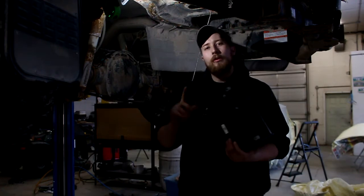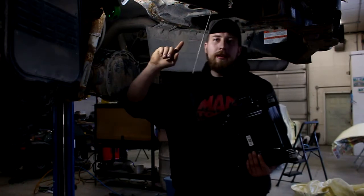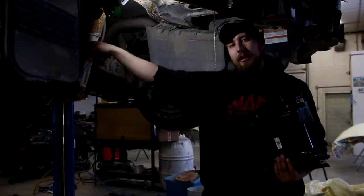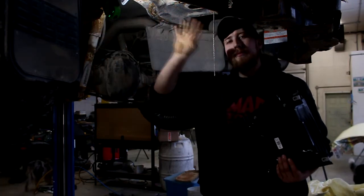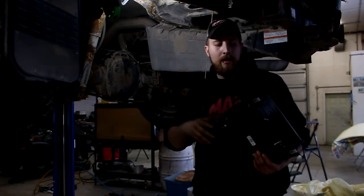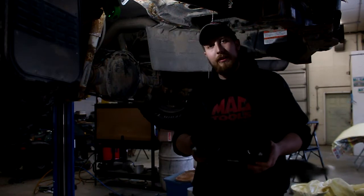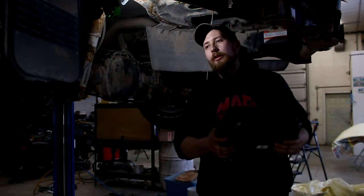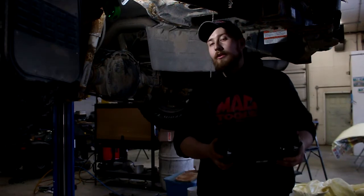The canister is going to go right up below the spare wheel and then you're going to be running a new vent line along your frame rail to the engine, breathing from closer into the engine bay instead of back here where it gets all this dirt. That's what's causing these to clog — they're filling up with dirt and then you have a slow fill symptom. It'll often start where you can only put in a dollar at a time, and eventually it'll get to the point where the truck can only fill 10 cents at a time.